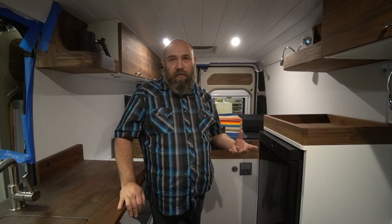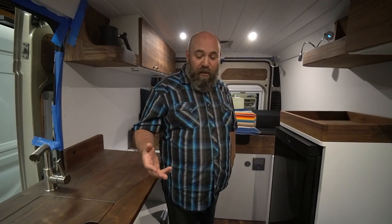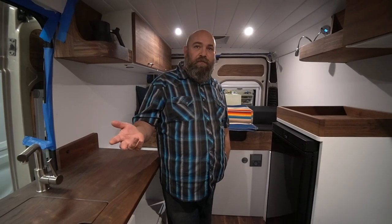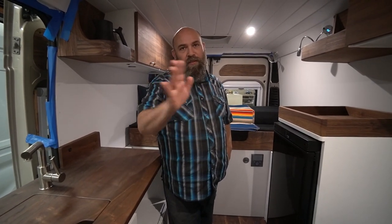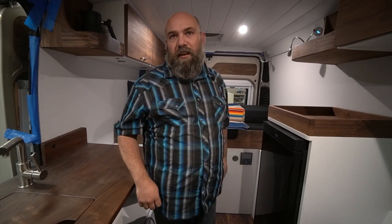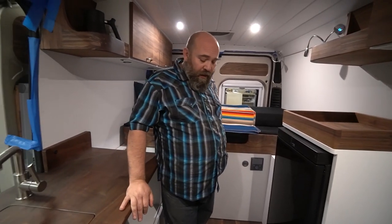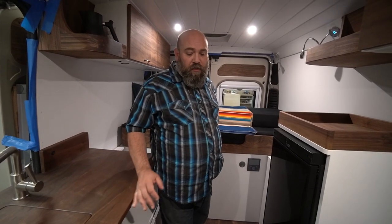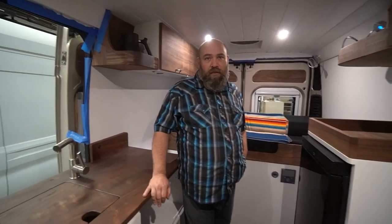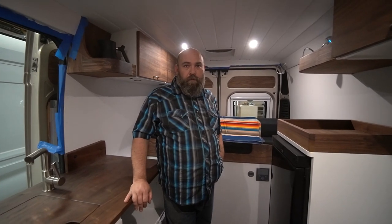There are actually 24-volt heated pads under here for electric floor heat — those are the ones Anthony spent about two days fixing. We had to fix them because the guys who originally put the van together threw bolts right through the middle of the heating elements — another electrical fire hazard. When we were ready to start building and finally checked the floor, the entire underside had a sticky heating mat with bolts through all the elements. If she'd turned it on, it would have been a fire hazard. But it does warm the floor — though the electric consumption is significant.